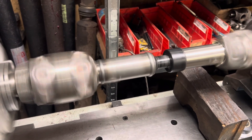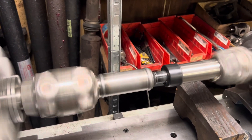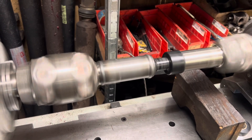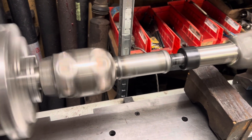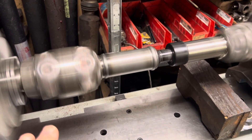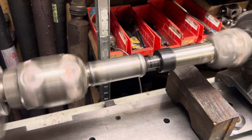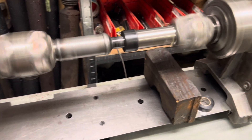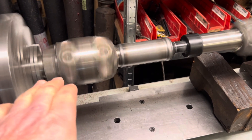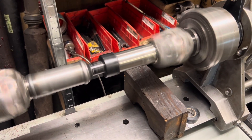Here we're going to take a look at my customer Hunter's rear driveshaft for his mystery Jeep. Hunter called me — his Jeep had a slip yoke eliminator kit in it and no drive shaft. He went through all the numbers and identified it over the phone. It came out to be 1310 series, needing a CV at the transfer case and 1310 down at the rear axle.